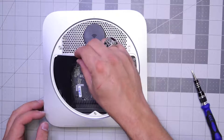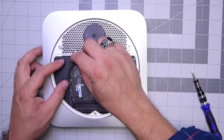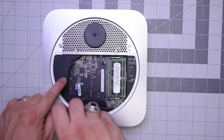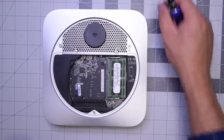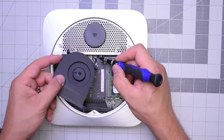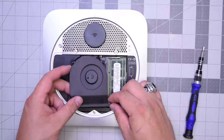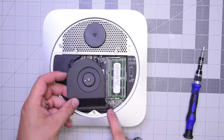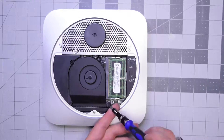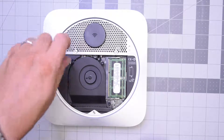Now place back the bracket — it's designed to protect the heat sink from the top of the case. Secure it with the T-screw on the bottom only. Then place the fan over the logic board and click in its connector — make sure it's firm and connected. Align it so that the long screw on the bottom goes all the way through, then secure all three T-screws.